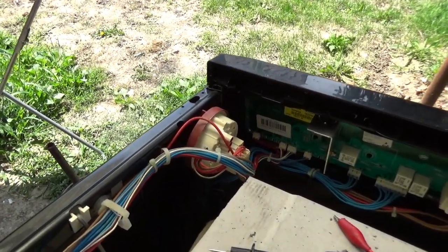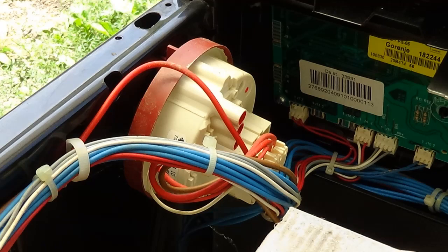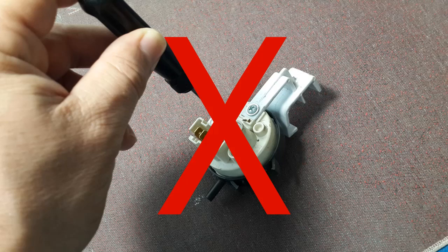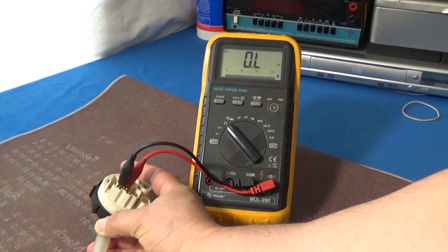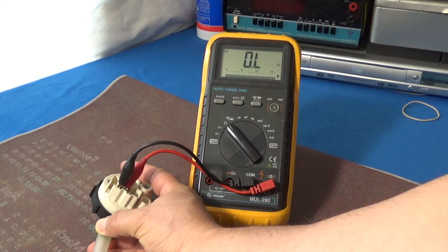From the valve, our next step is the pressure sensor. This kind of pressure sensor has some adjustable parts — please do not try to adjust anything. We don't have to adjust anything on it; its adjustment comes from the factory. If you don't know what you are doing, don't do crazy things. The way to test the pressure sensor is with continuity using the ohmmeter. It has internal switches — one or two switches probably. The test is very easy: we only have to apply some pressure. In my case, I'm blowing some air with a hose, and as you can watch here, the pressure makes the switch close or open. Easy test.